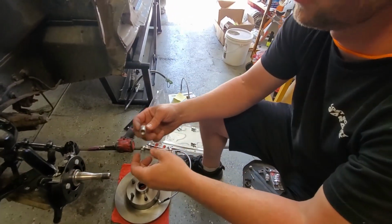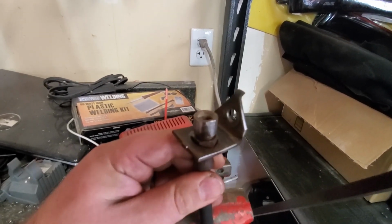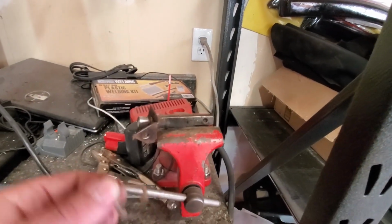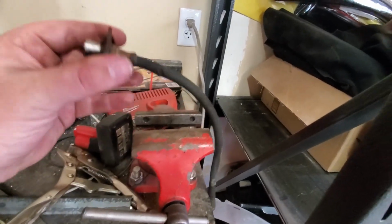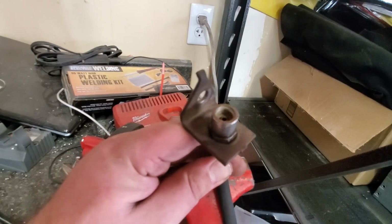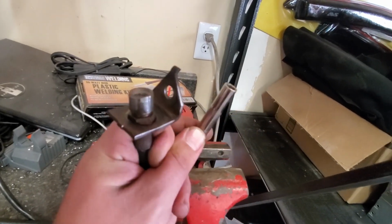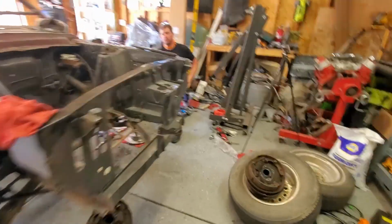because that fits directly onto our brake line. Now, a couple things when taking the old ones out: you're just going to pop off this bracket. Just like Wilwood throws in these new silver clips, you're going to pop this clip off. Also, there's a little, what I call horseshoe clip that keeps this within the bracket. So a good rule of thumb is to take a wire wheel to the whole thing, and you'll see that it's just a little hexagon. Pull out the clips and then just hit it with a hammer, or I used a small socket, put it right there and hit it, and it popped right out. We take these brackets and shine them up a little bit and de-rustify them. But just a little tidbit, it pops right out.